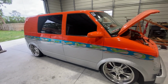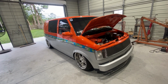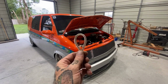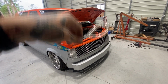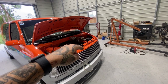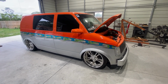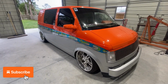All right, well, one last thing. I'm throwing this in, something I like to do. If your battery dies, your hood's down, can't use your poppers, well, I'm making an emergency hood latch, some cables, some hose, and if your battery dies, you'll be able to pop the hood, put a jump on the battery, and then you'll be able to get the truck open and go from there. So, figured I'd knock this out for the customer before he comes and gets it. That's all finished up.